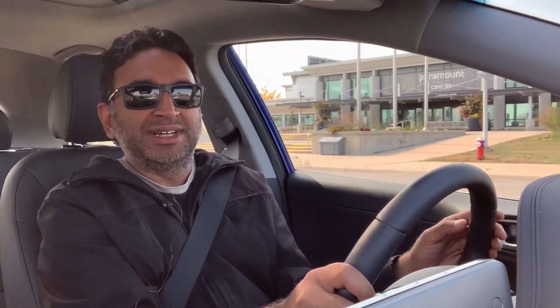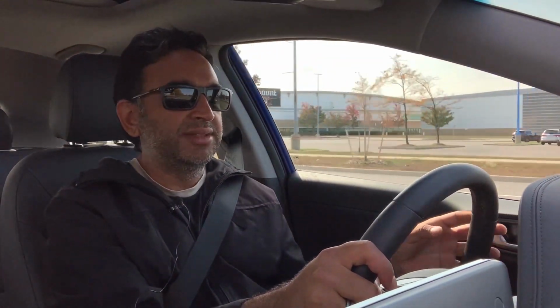And the reason for that is you can't just slow down a vehicle going, let's say, from 60 down to 30 because you see a red light far up ahead and not have any brake lights on. That's going to cause a collision, and the person in front of you will say, well, he didn't have any brake lights, I didn't know he was stopping. Not an excuse, but just saying. So Hyundai has made it very logical as far as pairing the brake light application to the one pedal drive.